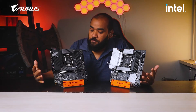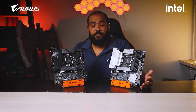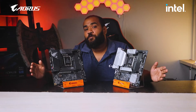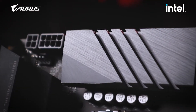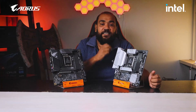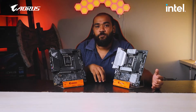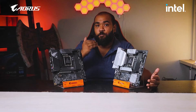Now let's talk about some of the new features added to the B660 chipset. To ensure high-end performance and high turbo boost frequencies, Gigabyte went with a 12-phase power design for Aorus Pro models. Basically there are 6+6 power phases delivering stable 60A power to the processor in the LGA1700 socket. Along with that, they included a VCC GT core phase whose main goal is to deliver 50A of power to the integrated graphics within the processor so it can boost as well, giving you better integrated graphics performance.